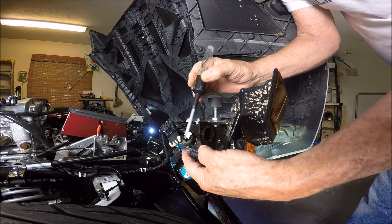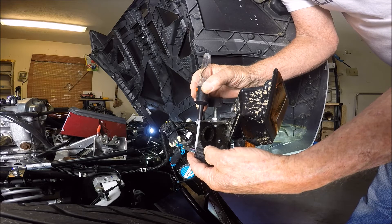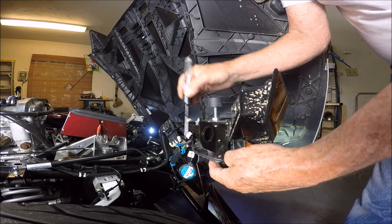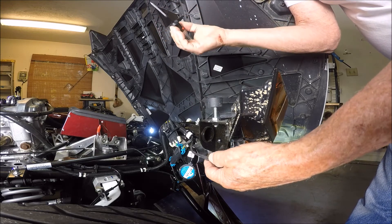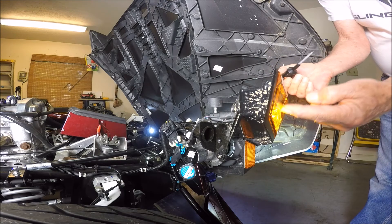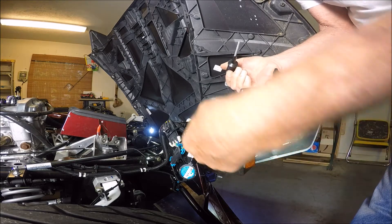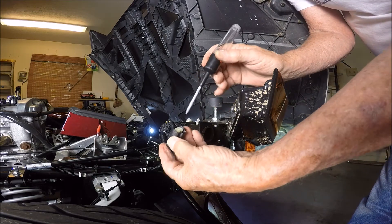There's my light flashing — I've got my turn signal confirmed. That would be the lead you connect to for the right turn signal: the blue with pink wire. Find a place in there where you can splice into it, connect the other side to ground, and it'll work fine. Now I'm going to plug this in and you'll see the side markers going, and the flashing of the front one.